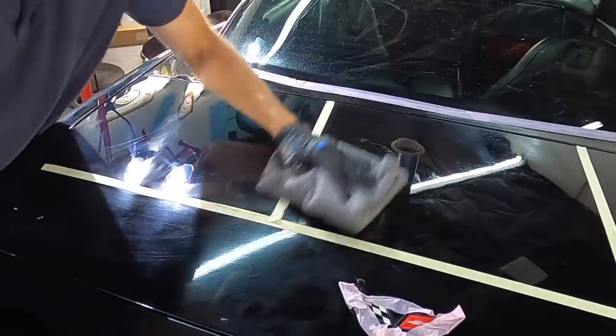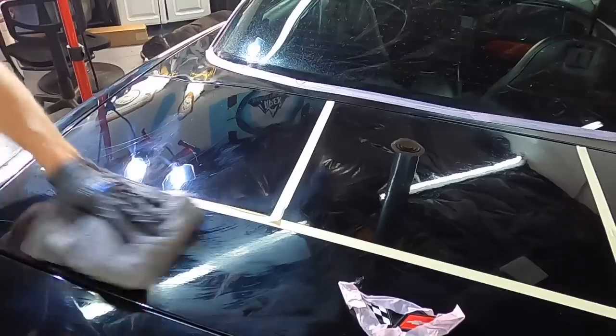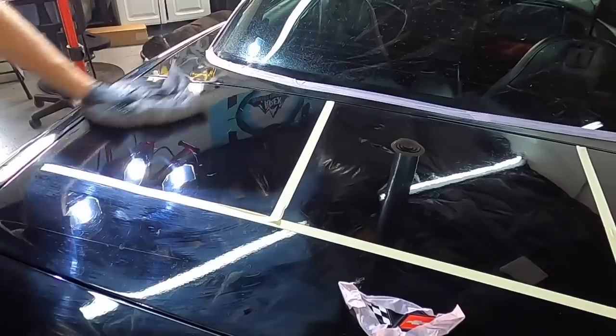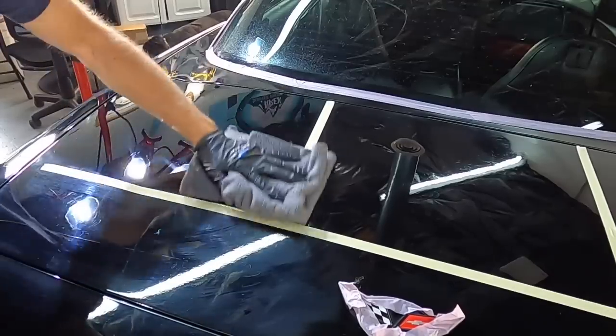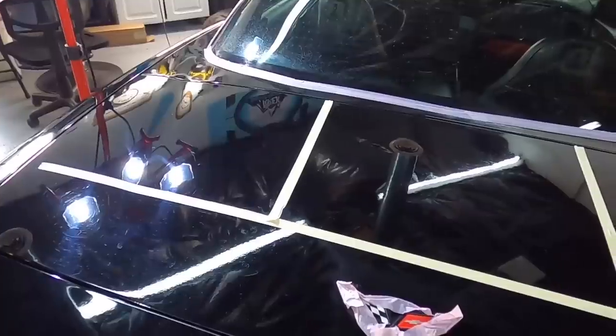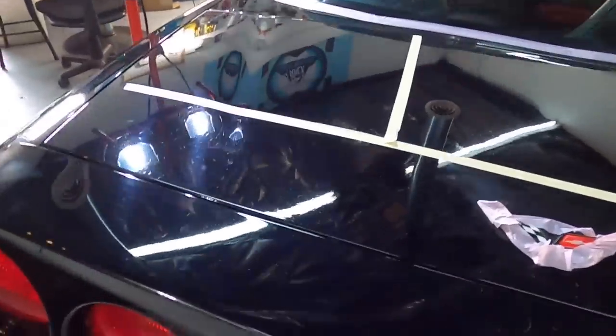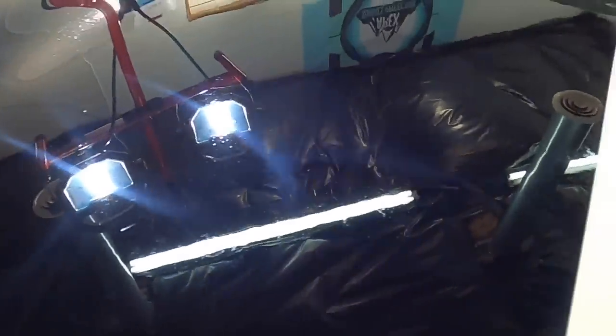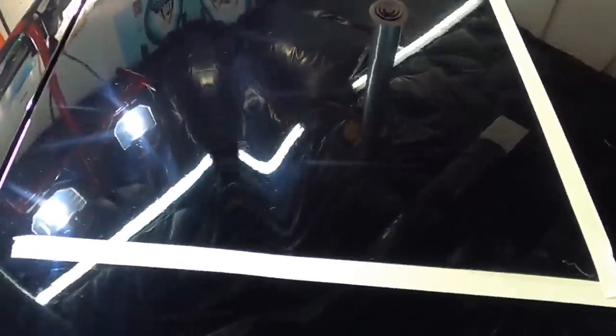There's a little bit of a trade-off when using the rotary polisher. Although it is like a scalpel — it will cut a lot deeper, a lot quicker, and is a lot more efficient — you will have a little bit more work to do, as the wool pads will lint a little bit. You'll have some dust and residue to clean up afterwards, and you'll have to check every seam and every opening between panels: opening the doors, the trunk, the hood, and then wipe down the corners.